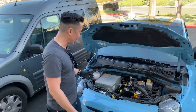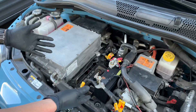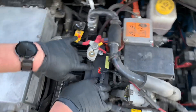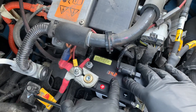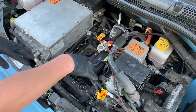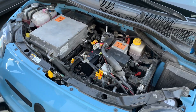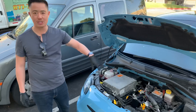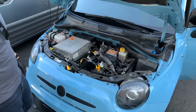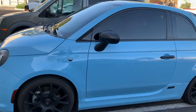So the question that came up on electric cars: how does an electric car charge the 12V battery, the way an alternator does on a petrol engine? We turned on the car and this was at 12.7 volts before — now it's at 14.2. So that means the main lithium batteries are charging this battery, which is basically for accessories, radio, and everything to get the car going. I think we're successful so far. We're going to do a couple of test drives to make sure there are no electrical system problems — this is kind of new territory for us.